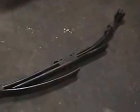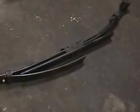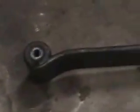And if you are wondering how, we can just do a short summary here, how I got the vehicle up and how to do this effectively with getting that spring out with the tension that it's under. First, just jack up the vehicle from the rear end. Use the rear differential, jack it up, place 2 heavy-duty jack stands under the rear frame rails, and support the vehicle, let it go, keep the jack under the rear differential, and then let that tension out, and you can support and lift and lower the rear axle as needed with the jack, the rear end going up and down so you can get that hardware out. It's not that bad.